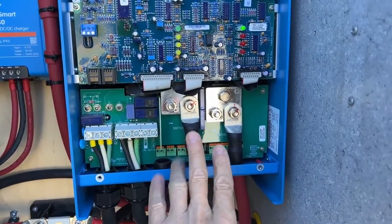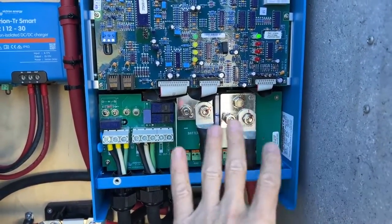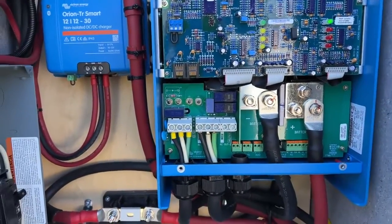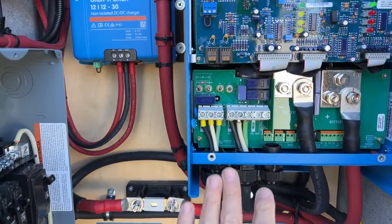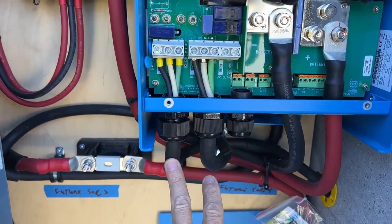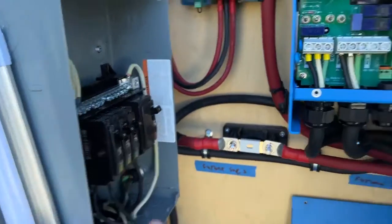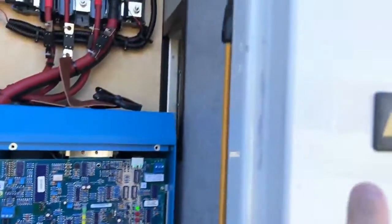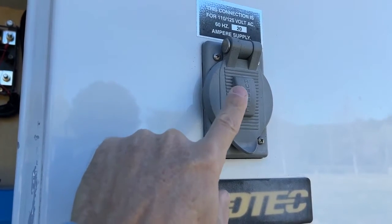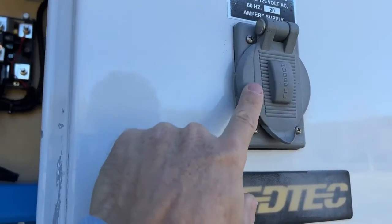The equipment is amazing. With the 3000 watt inverter, Victron really makes good stuff — especially for the marine environment. On the AC side, you notice on the Victron we have two cables. One cable goes to the AC breaker box — I used Square D for this. The other cable goes through the wall to shore power. So I could plug this into a house, a boat harbor, a generator, or a campsite — lots of options.